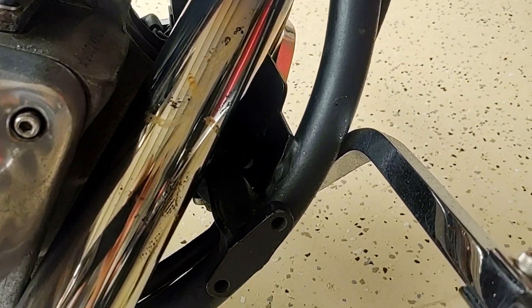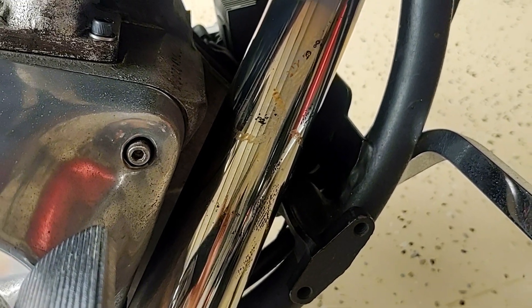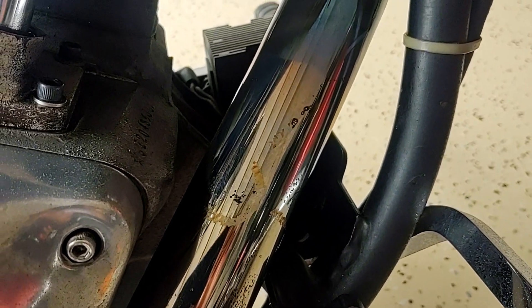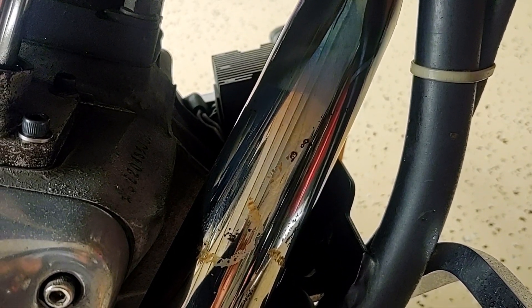As you can see there's still some left on there, but a lot of it has come off. I suspect that the rest of it will come off if I fire the bike back up again and bring the pipe back up to temperature. I think the key is to apply the Easy Off oven cleaner when the pipe is quite hot so that it sizzles, and that sizzling action is what removes the crust. So that's what I'm going to do.